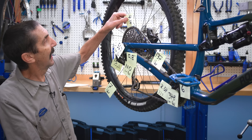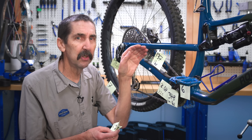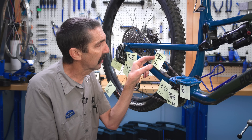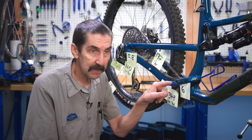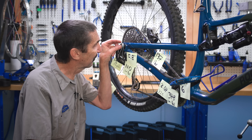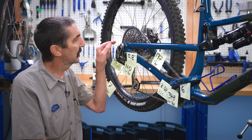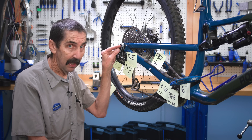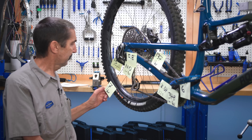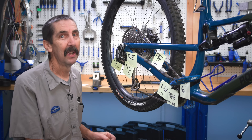But that is not everything, is it? We're still pushing here with 68 pounds. Let's shift down to the hardest gear — drop down to that 10-tooth sprocket. Nothing's changed here: it's still 137 pounds chain pull, I'm still the same strength, still the same 6-inch crank. But now the 10-tooth sprocket has a tiny effective wrench — only 0.8 inches, a little more than three-quarters of an inch. That makes our hub torque about 110 inch-pounds, and what we see down at the dirt is a measly 7 pounds of push on the tread.